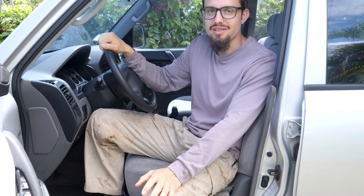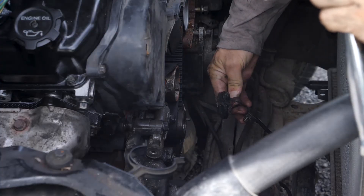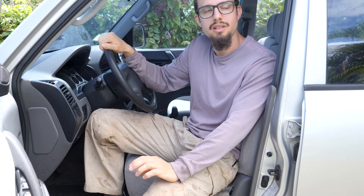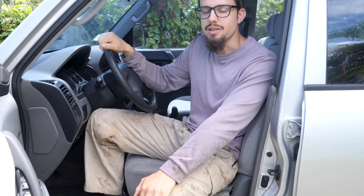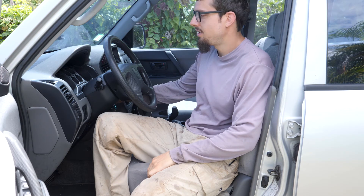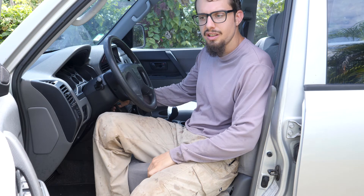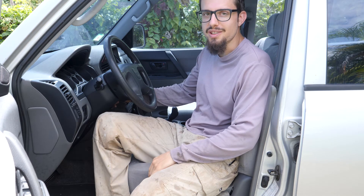Also the visible leak from the valve covers — I fixed that by adding a new valve cover gasket. We also had a crankshaft position sensor circuit error, so I fixed that by replacing the crankshaft position sensor. Ours was actually physically damaged, so there wasn't any problem with wiring — it was actually the sensor. And then lastly we had an O2 sensor heater circuit error, which I fixed by replacing the bank 2 sensor 2 O2 sensor. We've driven her about 58 miles since the repair and everything's been going pretty smoothly. She starts up pretty good. She's got a few old pulleys so she squeaks a little bit, but it'll be fixed pretty soon.